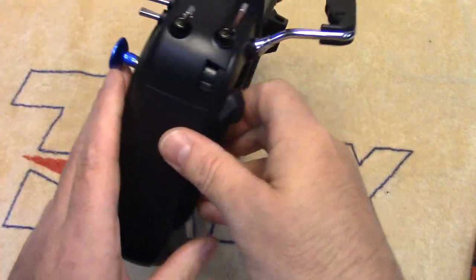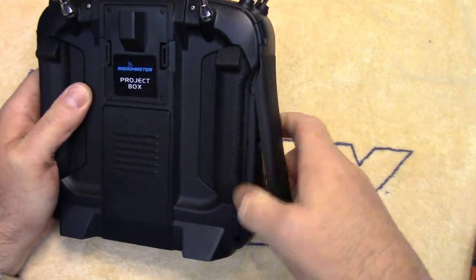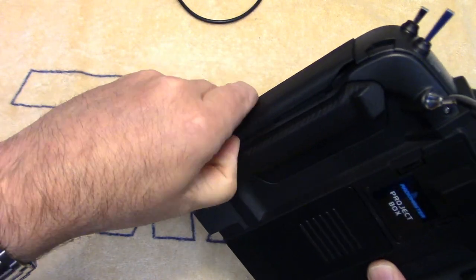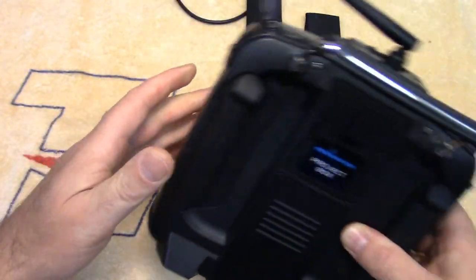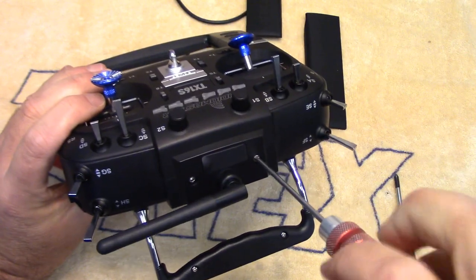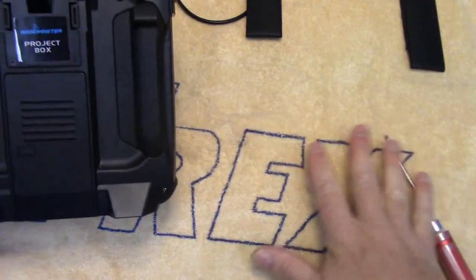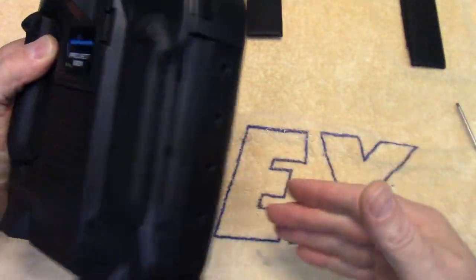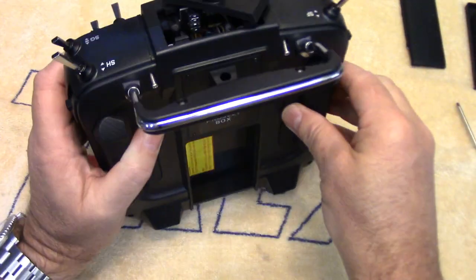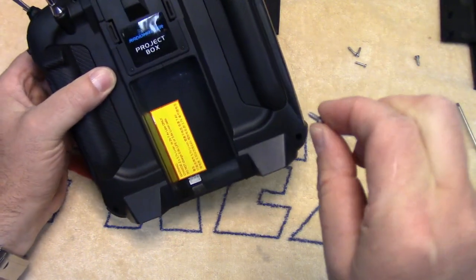Let's get inside. Opening these up is not too difficult. It might help if you leave it out in the sun for a while just to soften the side grips here — they just kind of peel off. There's just little dimples that hold it in and these little catches on the side. If they're soft from some heat from the sun it makes it just a little bit easier. Then we've got four Phillips screws on the back and two 2.5 millimeter hexes on the top. Take the battery out first, then get these screws out. They're all the same length — the four Phillips — and those two little hexes on the top for the antenna surround are a little bit shorter and fatter.